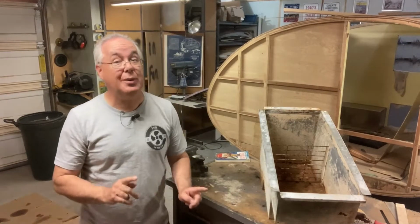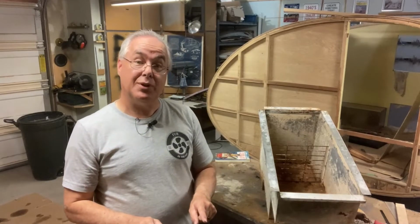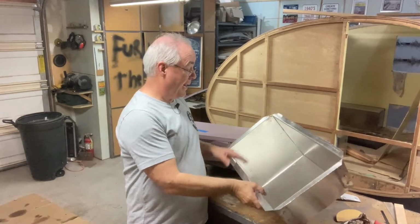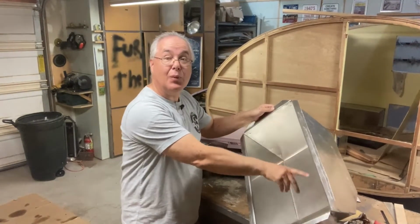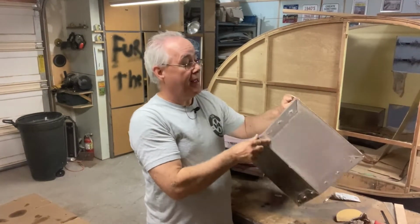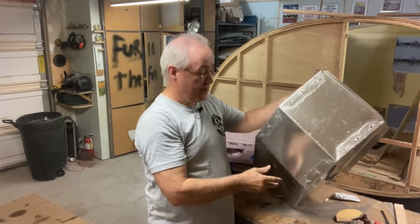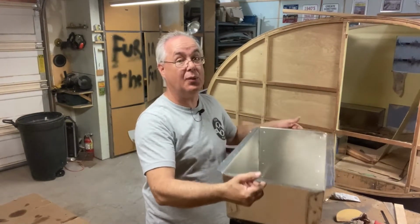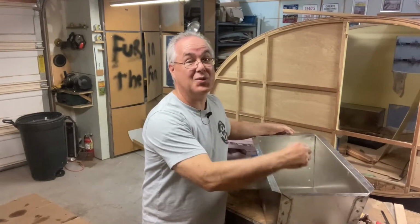Now we're gonna follow pretty much that same idea on our Icebox. Off camera, we went ahead and finished our box here. We riveted it up, we added sealant, we used some special metal adhesive glue that glued all of our seams together. And this is made of aluminum, so it's a lot lighter than our steel one, and we won't get that steel corrosion. I like this one a lot.